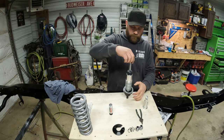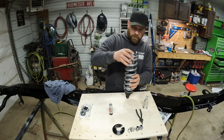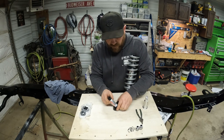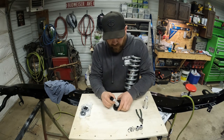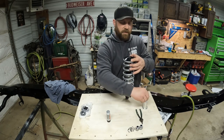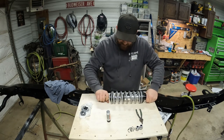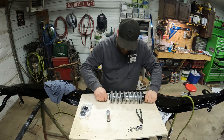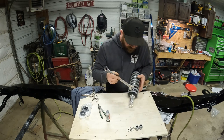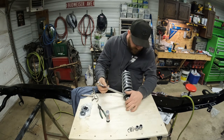Extend the shock as far out as it'll go, washers down like that. Take our spring, stick that on. Also going to put a little bit of anti-seize around the top edge of your top cap where that's going to be spinning, so it slides down in the spring like that. Then take our top piece, get that started, and wind it down to the jam nut. Tighten it down — in the instructions it says sneak a 7/8 wrench in there and tighten the jam nut. You definitely got to sneak it in because there's not much room.